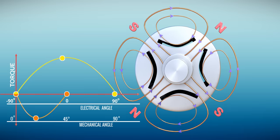The 2019 version of the Model S cars have IPM-SynRM fitted at the front. The IPM-SynRM motor has efficiencies of up to 96%, compared to traditional induction motors at up to 94% efficiency. Effective cooling of an induction motor's rotor is a big challenge, but this issue is not present for IPM-SynRMs. With the added advantage of reluctance, these motors have higher torque values than induction motors. IPM-SynRMs have definitely set new standards in the EV world.